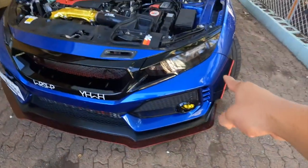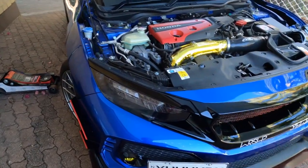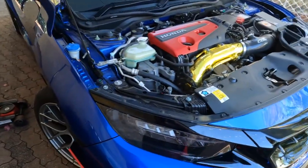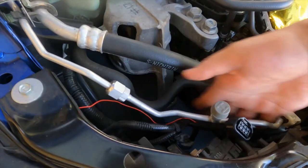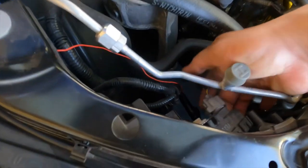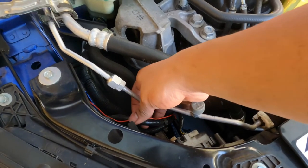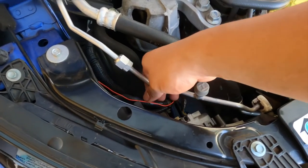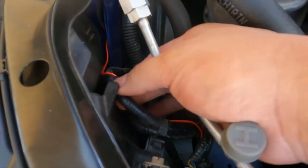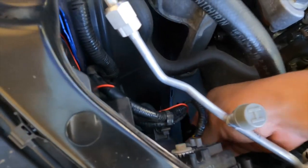So on this side it's on the blue wire, and on this side it's the green wire. For this one I'm not sure if it's the same with other cars, but we'll see now. Just connect this back in now, and you can make this neat and tidy if you really want. Just put these wires back in — you can tape it here, just not on this one because it will heat up. Just tape it there. So I taped it on there, made it neat. The clips are also good — clicked on, secured, and waterproof.